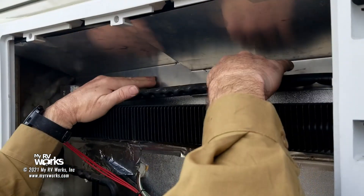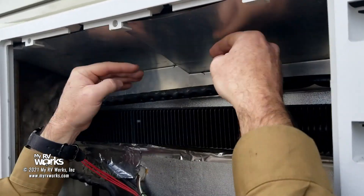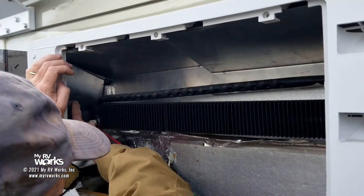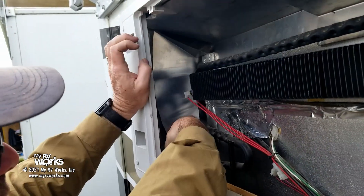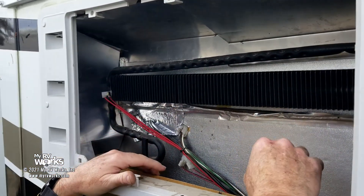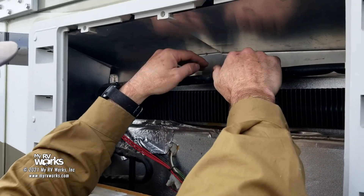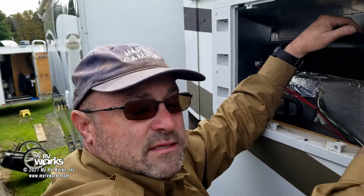It is going to be okay to screw screws right into the back of the refrigerator — we'll match these all up and screw them to the top. On top, air is going to deflect out. On the side we've got this fancy little piece that goes over here. We're going to put little angles on them and attach them here. We decided to make a video to add value for you on how to make these flashings, because if this is a pretty high-end fifth wheel and it came from the factory like this, imagine what some of these other RVs are like.